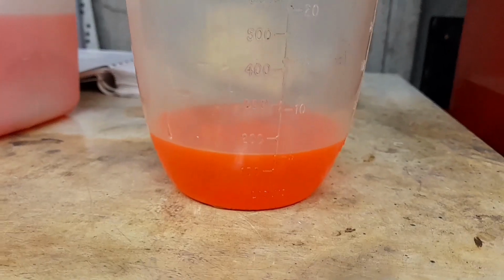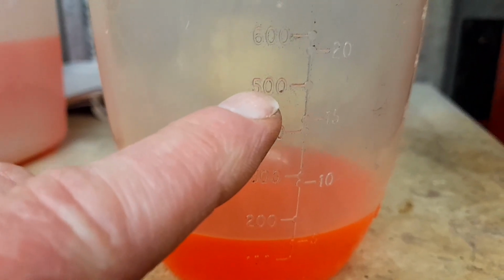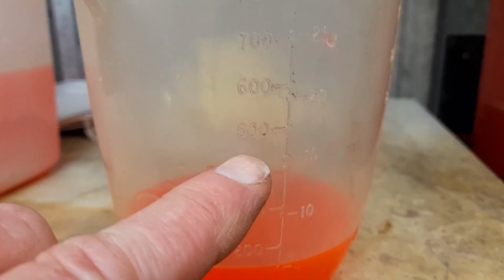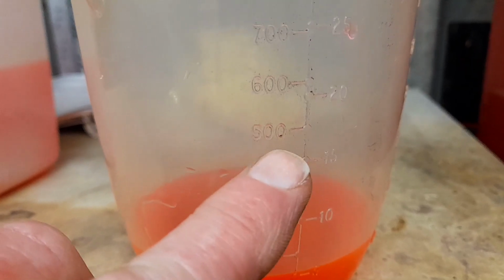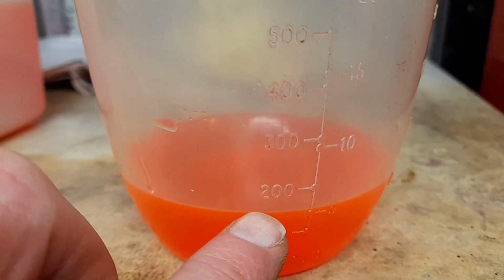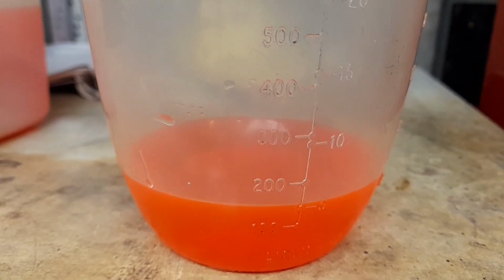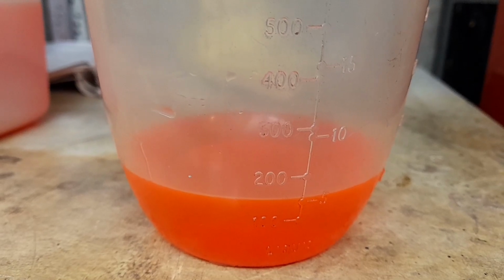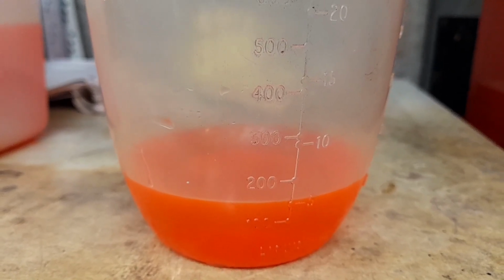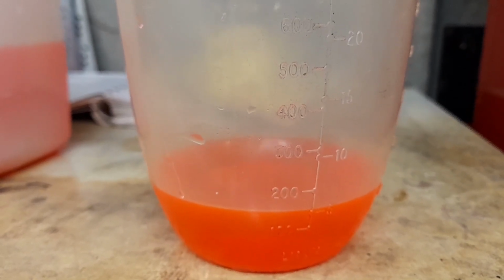So there you go. We're down to 100 ml. So I have, as I say, three litres, and then I fill this to another 500, and there's the amount I've put in there. So there's 1, 2, 3. Say I have put 350 milliliters in over and above the 3 litres that the manual stated. All right, and that hasn't gone through a heat cycle yet to see.